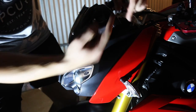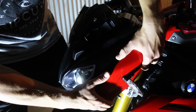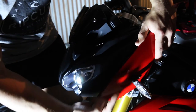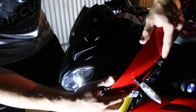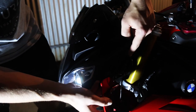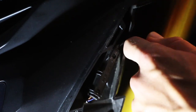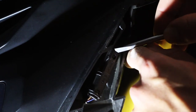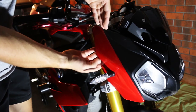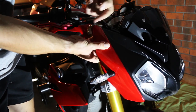Now from here there's a piece which clamps down around the plastic, so we need to slide this bearing upwards — just slowly work it out and upwards. After that's off, all we have to do is unplug this indicator here, then put a bit of pressure upwards while lifting this little locking lever. Then it's in towards the body from the rear — pull out from this top portion until it clicks, rotating under and then pulling outwards.